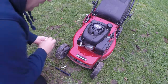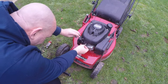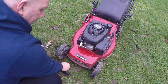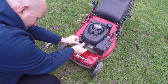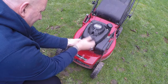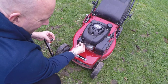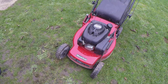Okay, so I've got a brand new spark plug. I'm just going to fit that into the lawnmower now. Always be careful just to hand tighten these at first until you get the threads running. Once the threads are running, you can then back that up with your spark plug spanner. It doesn't have to be super duper tight — just once it's snug, just one quarter turn. And then reattach the HT lead. So we've now done the oil change, the air filter, and the spark plug.